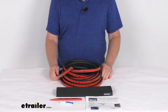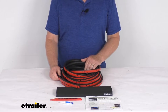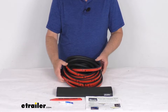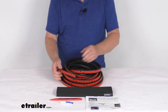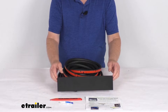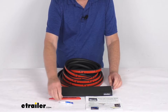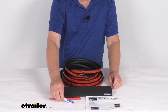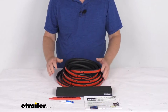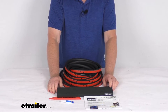This will let you protect the inside of your enclosed trailer using this hollow half round seal ramp gate kit. This will help prevent water and debris from entering your enclosed trailer, and the kit will include everything laid out here on the table. It starts with this 35 foot long hollow half round seal with the 3M adhesive tape, the ramp gate corner seal, this plastic scraper tool that's used for removing your old seal, this tube of Loctite super bonder, and a nice detailed instruction sheet that will describe how to install this. This kit will provide this perimeter seal and the corner blocks found on many of the toy haulers and car trailers.